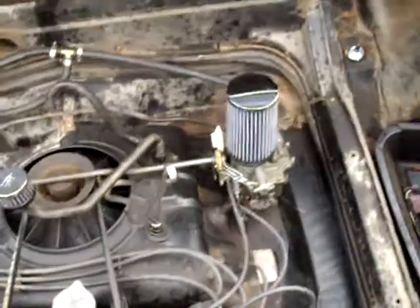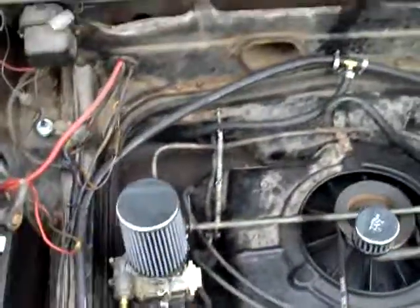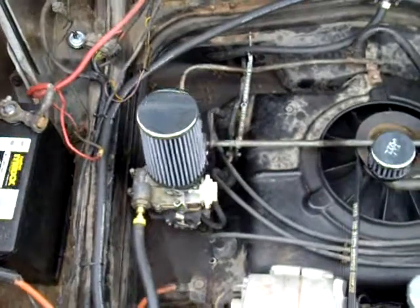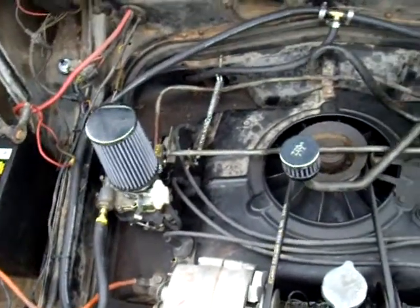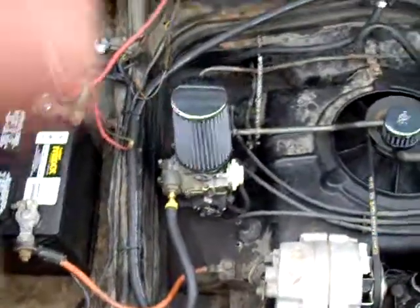Here's the gig. When we did the plug pull off, all of the driver's side bank is totally useless — it doesn't do anything, no RPM drop. I have a video that shows a little bit of RPM drop, but you probably won't be able to tell.